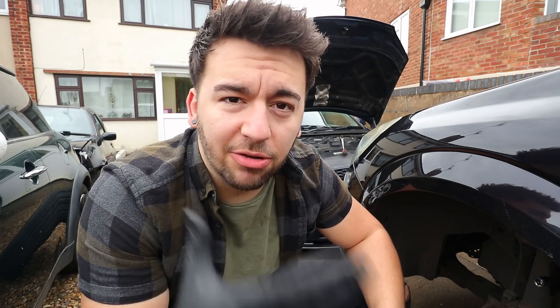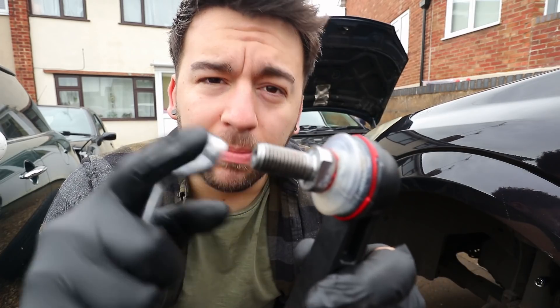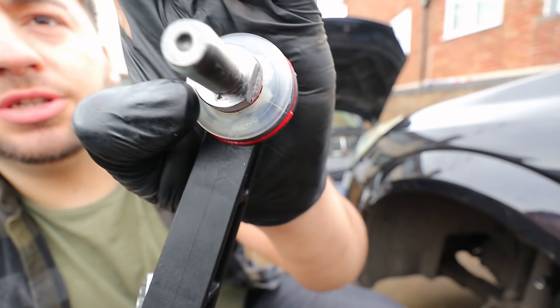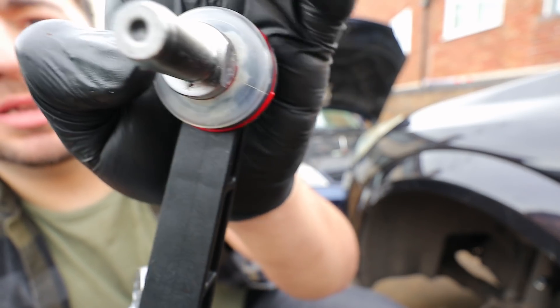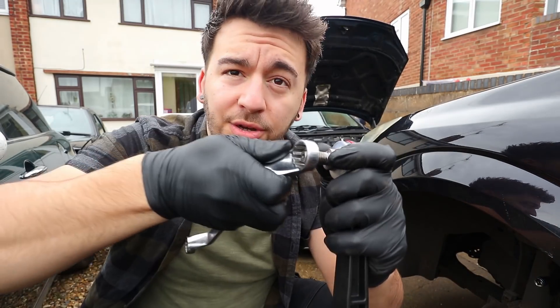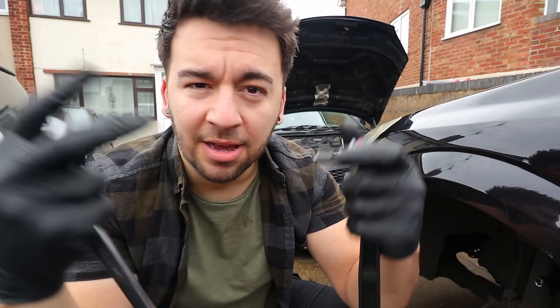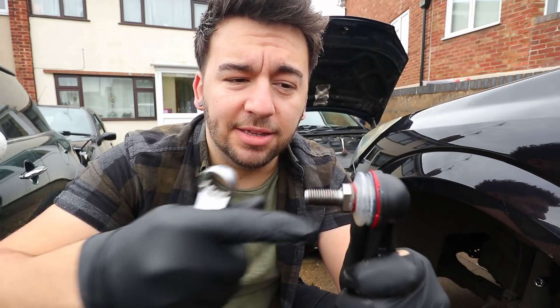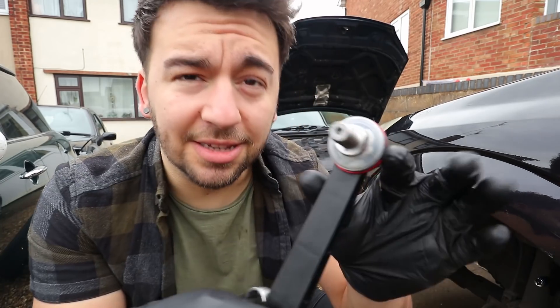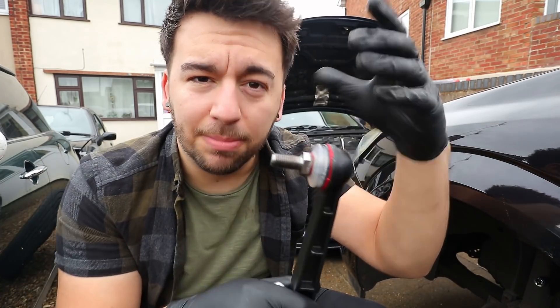When it comes to removing drop links on your car there's actually usually two different orientations or ways that you are able to remove them. Luckily enough with the drop links that I'm using today I've actually got both types so I can show you exactly what I mean. This is the brand new one that we're fitting today. As you can see on the ball joint where the bolt's going to go, there are flats machined into two sides of this — that enables you to put a spanner on them to hold the ball joint still so that when you undo the nut the ball joint doesn't just spin, because if the threads are rusted and corroded, the ball joint will just spin and you'll never get the nut off. So in this instance you'd be able to fit a spanner right where those flats are and then you can undo the nut without the ball joint spinning.